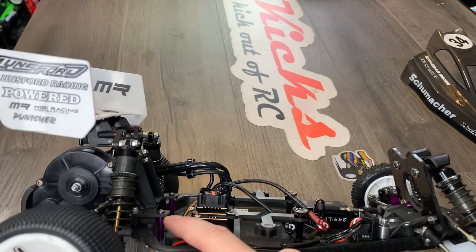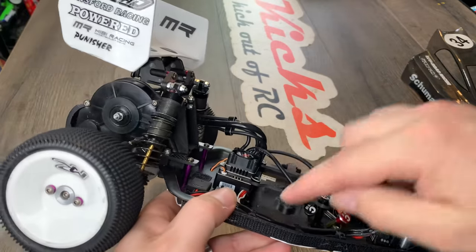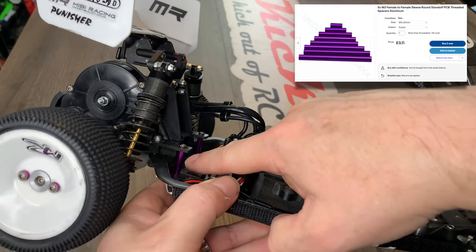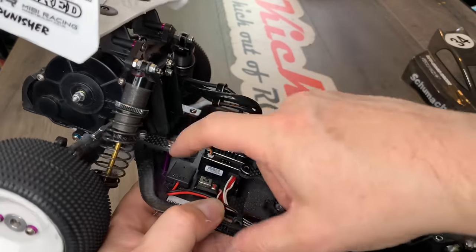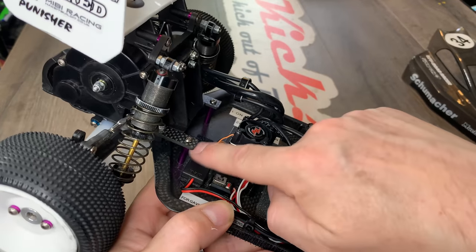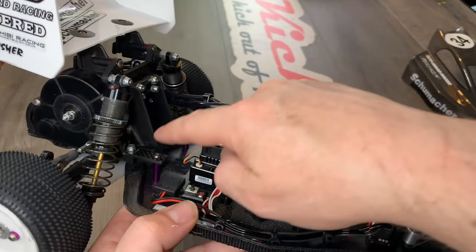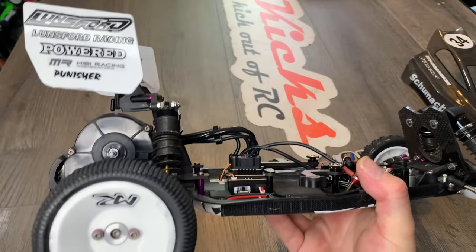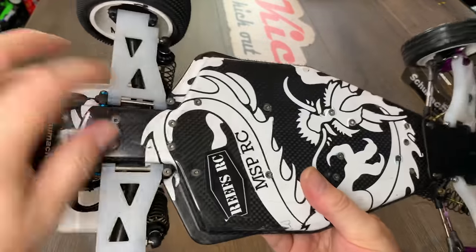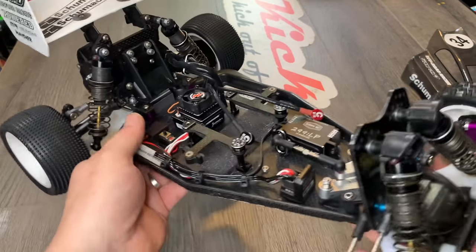Next there's a brace here that I actually made myself — just 20 mil standoffs, though really you need about 19 so I had to put a shim in there. The carbon bits I made myself by cutting up an old piece from a different car and shaving it down. The idea is to give a little bit more support from the back of the car when it gets hit, to prevent it from twisting and stressing the bottom of the chassis. Some companies do sell these but I just made my own. All the screws have also been changed to titanium.